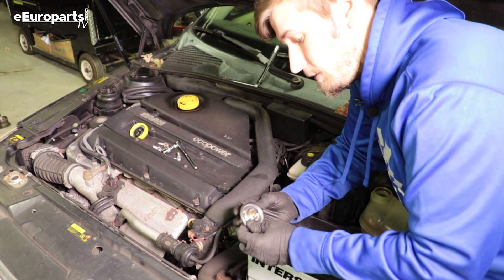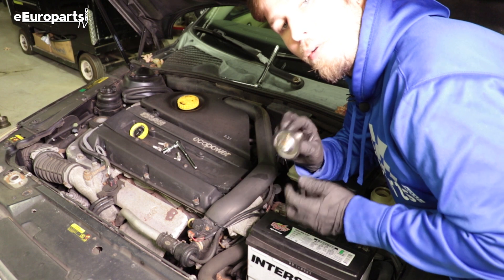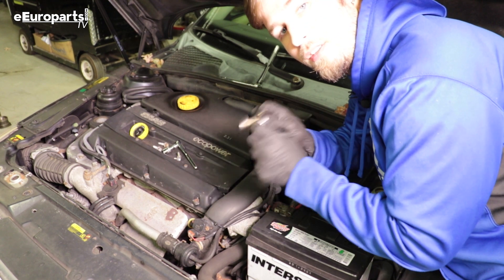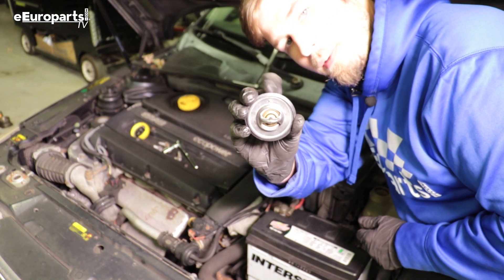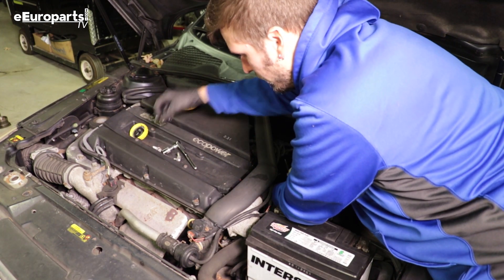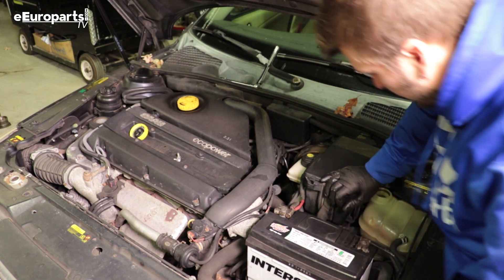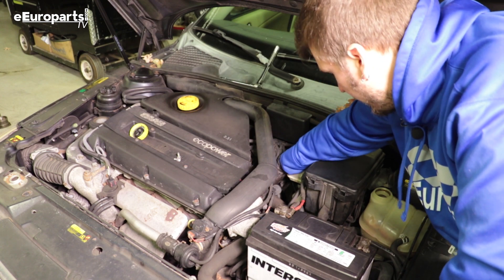This part is important. There's a little air valve here that helps the system self-bleed, and it always has to be facing upwards. If it's upside down, you will definitely have some problems. So make sure when it goes into the cylinder head, this tiny little valve is always facing up. Once you have it seated, go ahead and put in the two main mounting bolts. Then you can replace the electrical ground and the stay onto the outside of the thermostat housing.